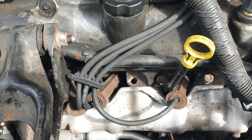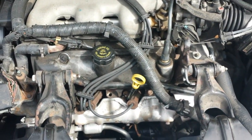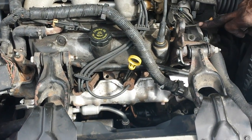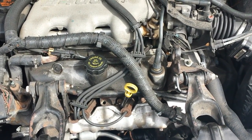I pulled that off and as you can see, both of my fans came on immediately — you can hear it. Both fans came on, so that's telling me my fans are working properly. If for some reason they're not coming on like they're supposed to, you possibly have a bad relay or a bad temperature sensor that needs to be changed.